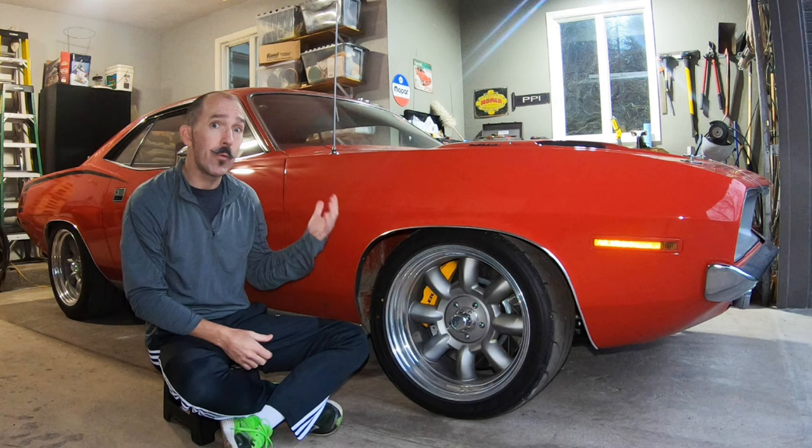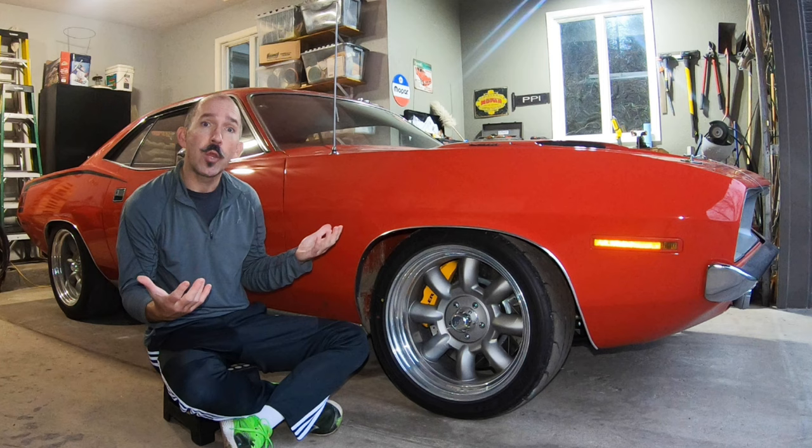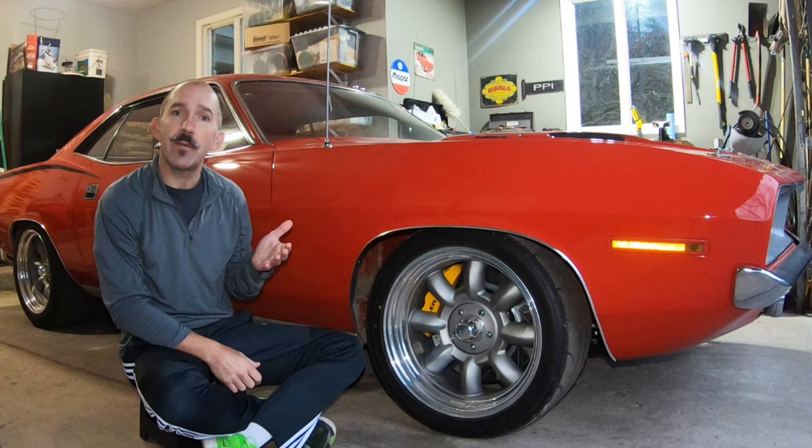In case you're new to the channel, a quick rundown on the vehicle: I had the original 383 in storage, but this is a 400 stroked to 471 cubic inches. It's the factory 23 spline 4-speed, and it has a Gear Vendors overdrive on it and a McLeod RST twin disc clutch with 373 gears in the 8 3/4 rear axle. I did that a couple years ago. This year, the project has been the suspension and brakes, wheels and tires.